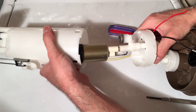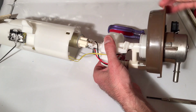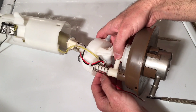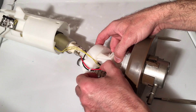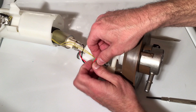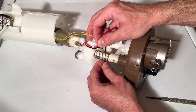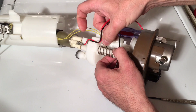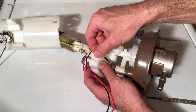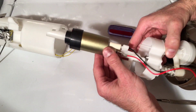There's your fuel pump — go ahead and release these wires here. There's a little clip right there; pull all that out, get all those wires pulled out before you get everything pulled so you don't damage anything. And there you have it.